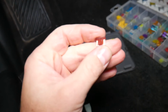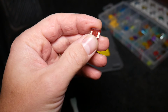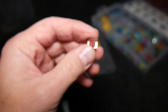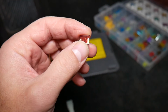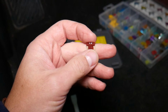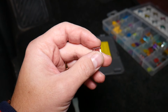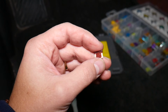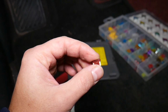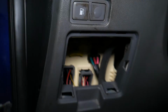Never assume that the fuse is good if you cannot clearly see the element inside. Sometimes you can see it and it's still a bad fuse. So what I would recommend, always test these fuses. We have a video that explains how to simply test it in a few seconds, and I'll put the link in the description of the video below. Once you test the fuse, you will know for sure if that's the fuse that's causing that problem. So always check it, because if you think you have a good fuse but actually it's a bad fuse, you will keep putting more time and money in your car, which is not necessary when you could have avoided that.